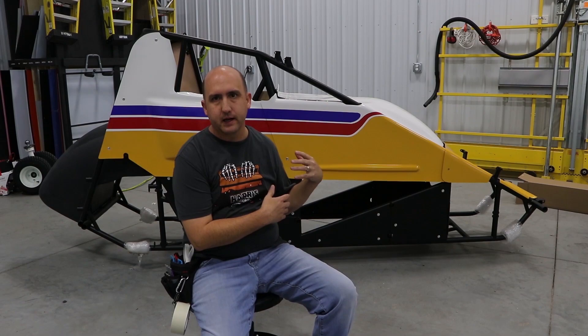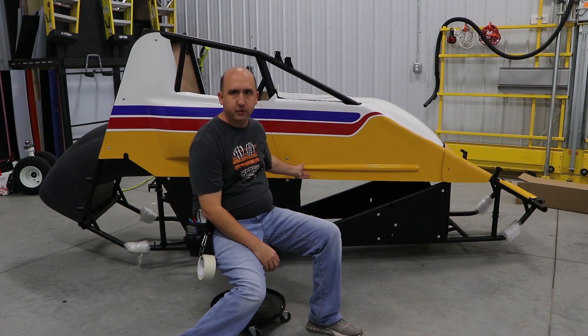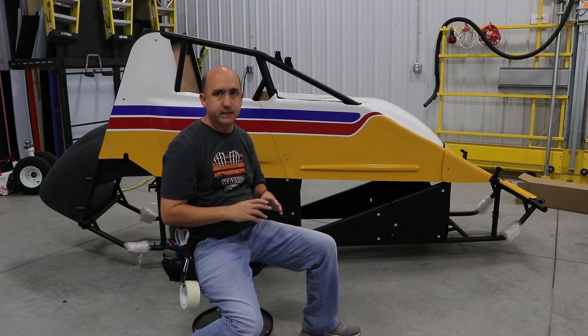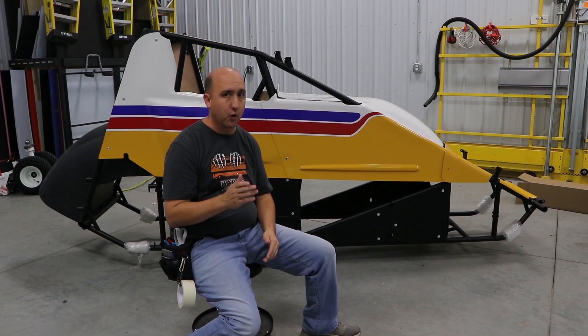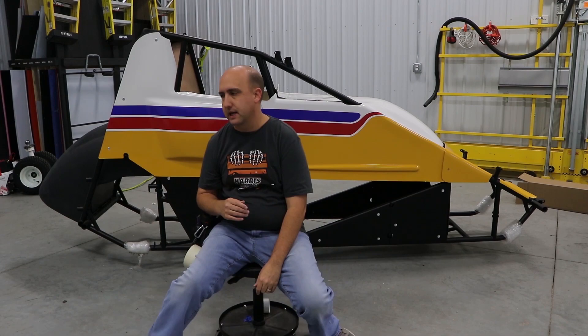As you can see, I was working on the side getting it all wrapped and a lot of the parts turned out really sharp, especially around these edges. This is something that typically a lot of people don't wrap completely — they'll slit part of it and overlay it. What I did was go a little more creative and gutsy and actually wrap around it. The key when you're done is to get your heat gun, get heat on it, and warm the whole area up to about 160 degrees to bake it right in. If you don't do that, any stretching you did around that will pop out in about six to eight hours and become a bubble — and that's what you don't want.